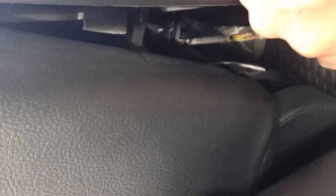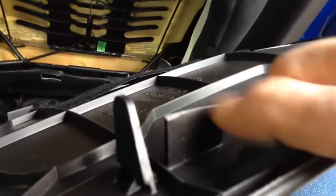For this bottom edge it's particularly tricky. You have to pull that aside — I just managed to release one of the clips, but you have to try and get in and release this clip, poke in with a screwdriver and try to lever it in between the plastic and the metalwork. I was lucky — this managed to pop out, and you can see the construction of the clip there. Having released the two bottom ones, you can pull down to release the top. Here we can see how all the seat clips go on, which should help you remove your own. I was lucky — this one somebody had previously broken trying to get it off.